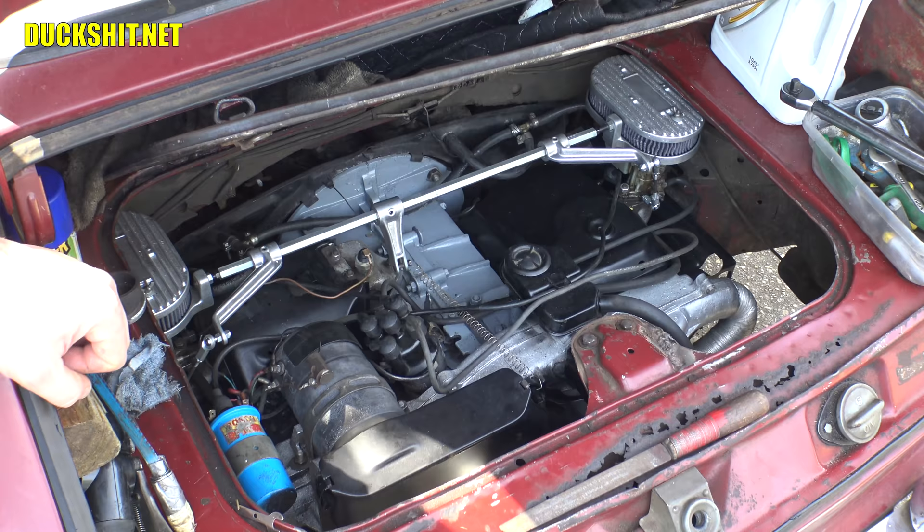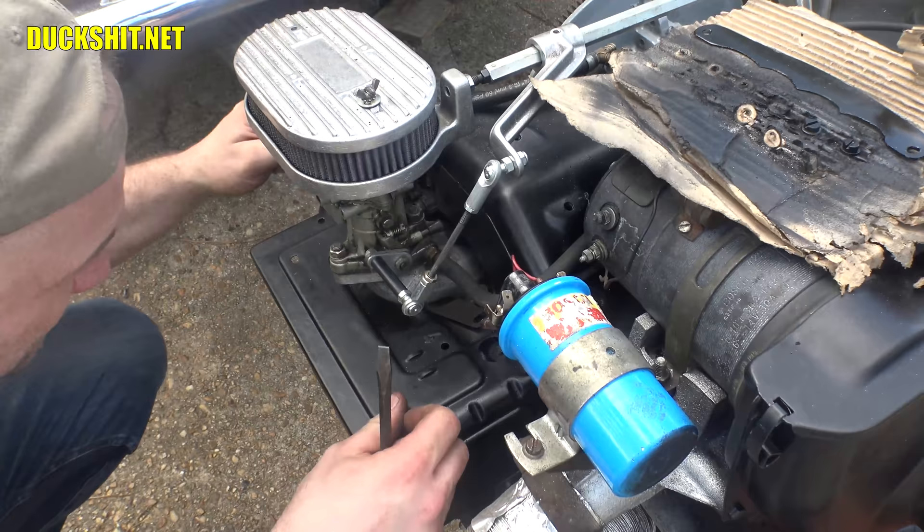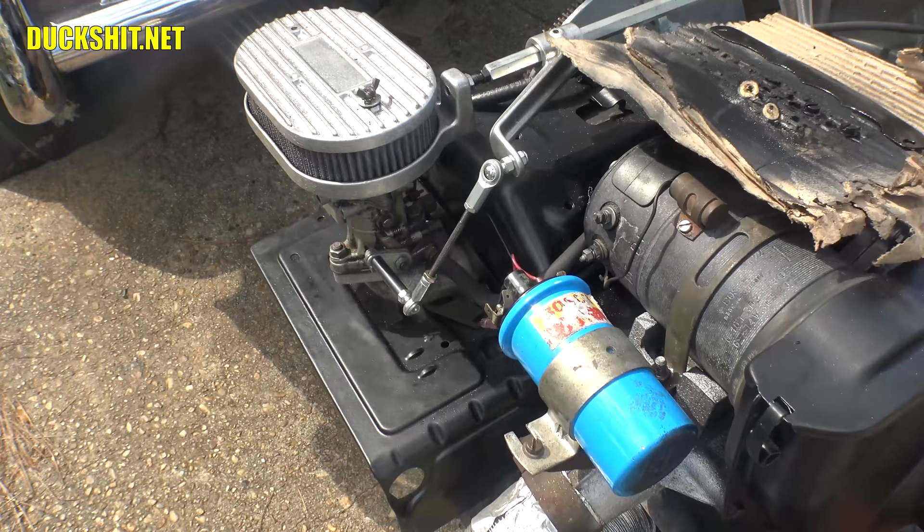So that's why the generator didn't get painted, and I don't feel bad about it. I am extremely pleased with the engine and the way everything went together. Yesterday I synchronized the carburetors and was ready to take it for a drive, when I discovered some of the throttle linkage was actually hitting those special little plates I made that covered up the giant gaping holes in the engine tins over the heads.